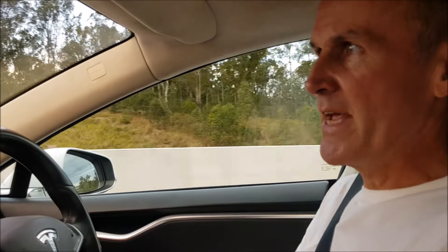In this video I'm going to talk about Model S and Model X cars, and if you are in Australia this may affect you. It is about non-performance model rear-wheel drive Model S and also performance models with the large drive unit in the back. There is a common potential failure that happens around the world on these early Model S, which is a coolant leak where the coolant seal lets coolant into the stator housing of the electric motor, soaking the stator. Coolant also leaks into the inverter, which can cause catastrophic failure of the motor. What I'm going to say may sound a bit harsh, but I believe Tesla is abandoning Model S owners with this potential issue.